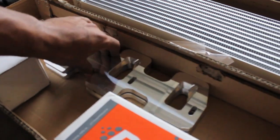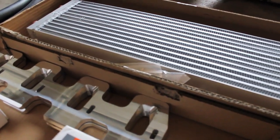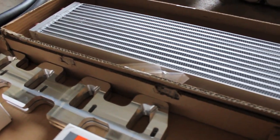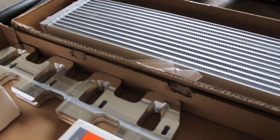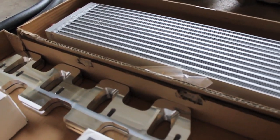I got head adapters because I will not be running LS3 heads. I'm going to be keeping my factory 243s, and yes, they will clear the hood, but you will have to do some trimming.